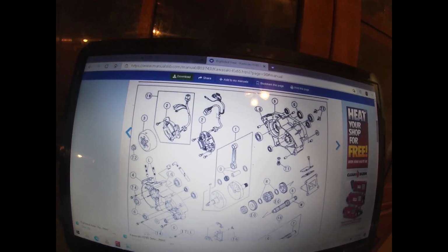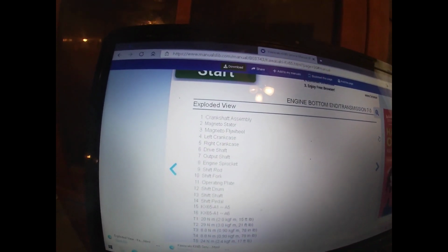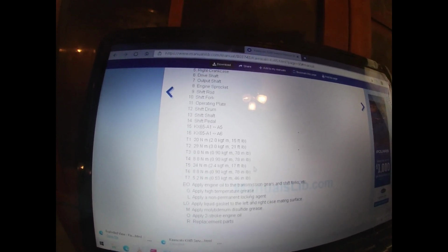I'll see if I can leave this link in the description, but what's most important is you go to your next page here. And so this has all your diagram, crankshaft assembly, magneto, all that. And what's important is when you get down here to your T's. So your T1, I believe, was your gear selector. So that's 15 foot-pounds. T2 is 21 foot-pounds. T3 is 78 inch-pounds. T4 is your case, and that's 78 inch-pounds, not foot-pounds. T5, 17 foot-pounds. T6, 78 inch-pounds. And T7 is 46 inch-pounds.